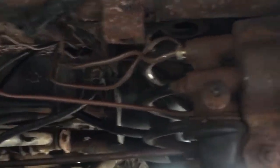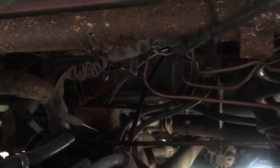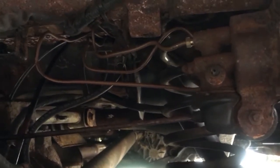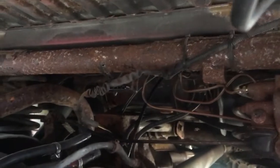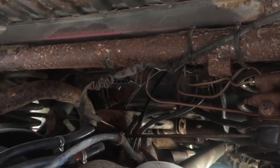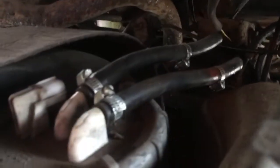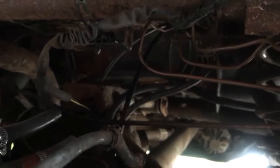You can see some of the new brake pipes that I fitted. I actually did the brake pipes last year but time's flown, I've only just got around to carrying on where I left off. I replaced the pipes that go to both back wheels, into this compensator valve that allows for load, and then all the pipes from there towards the front of the truck — they join about halfway down where everything from halfway towards the front was okay, apart from one corner, actually both corners. The pipes up to the master cylinder were alright, but the pipes from the master cylinder to the front wheels needed replacing as well, so I did those. I've also replaced these rubber hoses and replaced the main fuel pipes to about halfway down the truck with plastic ones because they were all rotted.